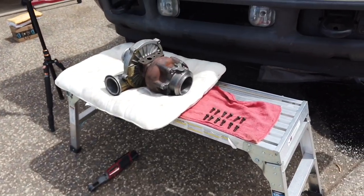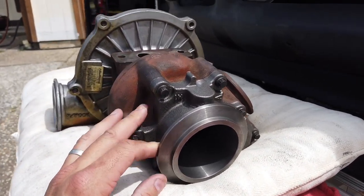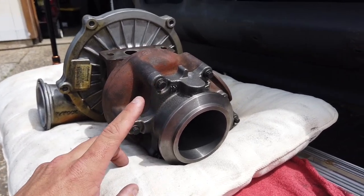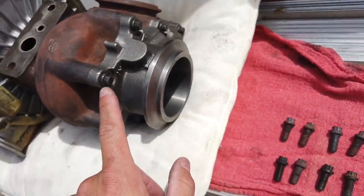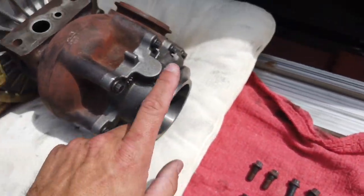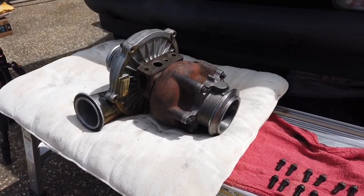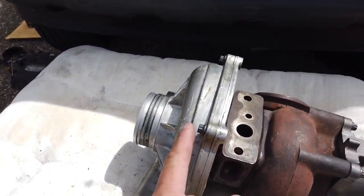And now that the pedestal is kind of in place, temporary, we got this replaced with the exhaust back pressure valve delete, this little housing, replace the bolts. We got 7 bolts on here. New ones on here, and then since I bought 3 packs, I changed these bolts as well. There's 5 on here, 7 on here, so we've got 12 total. So I bought 3 packs. 3 packs would be enough to do this side and that side, and you're gonna have maybe 3 or 4 left. The bolts on this side, you need 7, and 1 pack I believe holds 6. So you're gonna have to buy 2 packs regardless. And you're gonna have leftovers, so might as well do 3 packs and replace these and those, but that's up to you.